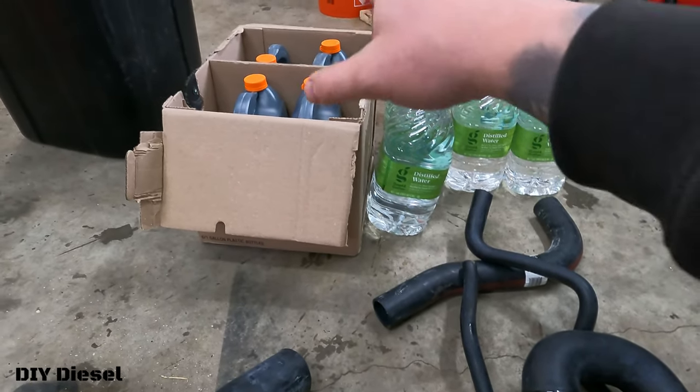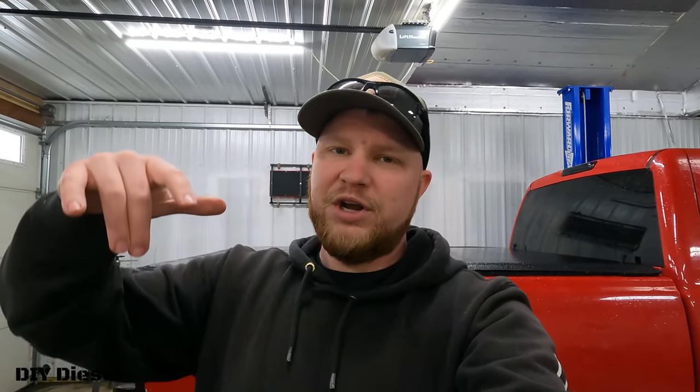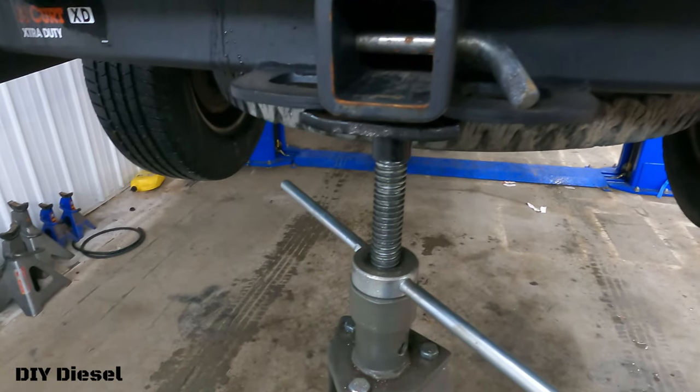You need to make sure you have enough concentrate and enough distilled water. The reason you want distilled water is because you don't want any minerals getting into your system and corroding it — that is highly important. The concentrate is a lot cheaper than the 50/50 blend. The 50/50 blend is more for topping off your coolant or smaller jobs. When you're completely draining the system, get distilled water and concentrate. I cannot express how important distilled water is — corrosion in your cooling system is a real thing.